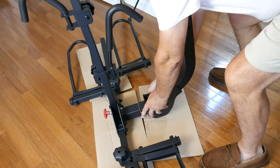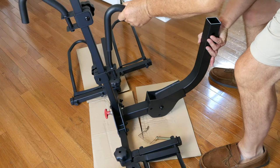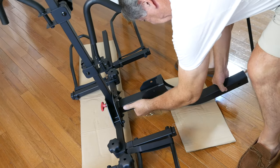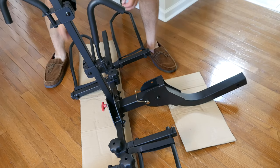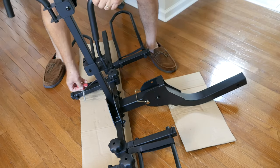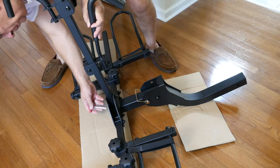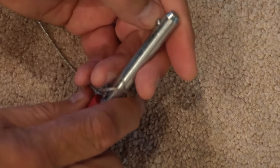During assembly this folding rack was shown in the up position. Watch as I demonstrate how the rack would appear folded down in preparation for loading your bikes. To prepare your bike rack to fold up out of the way, first pull the red-handled pin and fold the center tube down in either direction. Note that neither lock hook has to be first removed for this operation. You may be wondering what holds the red-handled pin in place — it's this small ball bearing near the tip, which is compression fitted with a spring underneath.